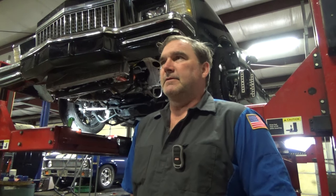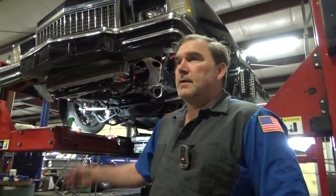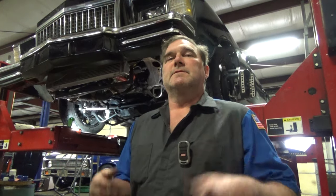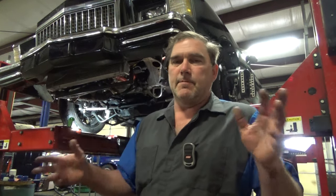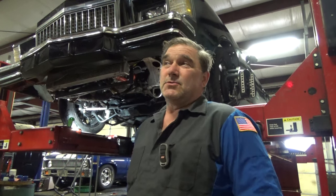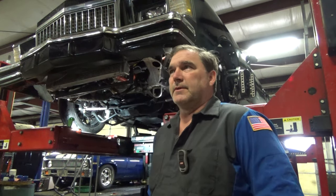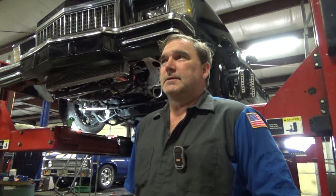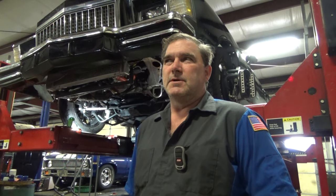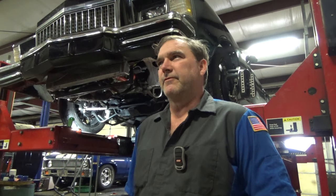The front ride height is dead even. I've dialed my Viking coilovers back down to zero just so that I get good cycling with the suspension — that way it's not hanging up and doing weird things or giving me strange readings. My initial readings are pretty out there. I've got a ton of crossed camber and I haven't quite figured out why I've got such a large amount of crossed camber, but we will figure that out.